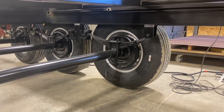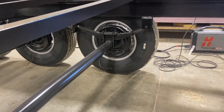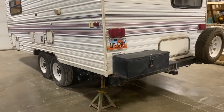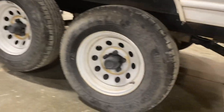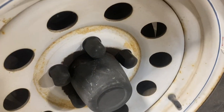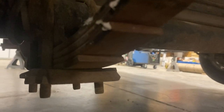We're going to do it the right way and show you how that's done. The first thing you want to do is get this jacked up so your tires are off the ground. Make sure you've got jack stands on all the corners. Rather than undo all the U-bolts — which is very time consuming — I've got a plasma cutter and I'm just going to cut these U-bolts.